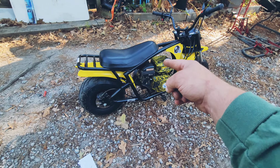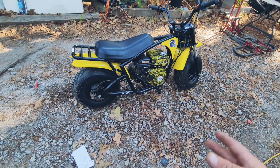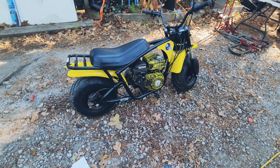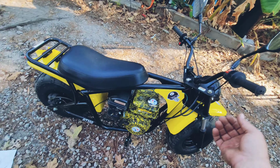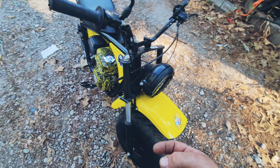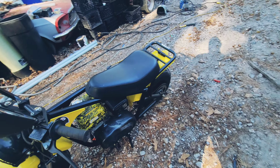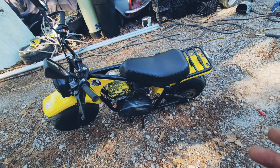According to GPS, this thing reaches about 35 miles per hour in that area. That's not bad. And it felt like that was about top speed, so it didn't really have much more. The clutch engages kind of rough, like it has a low, high stall speed. So I need to figure that out. I'll probably look at the clutch. It probably needs grease or something simple.